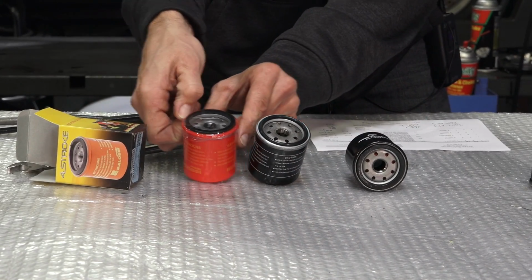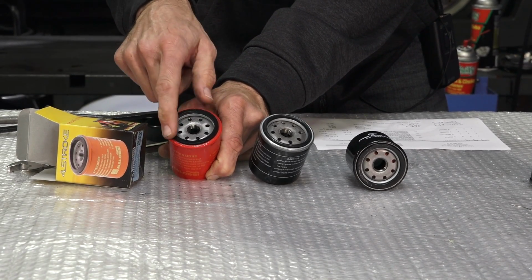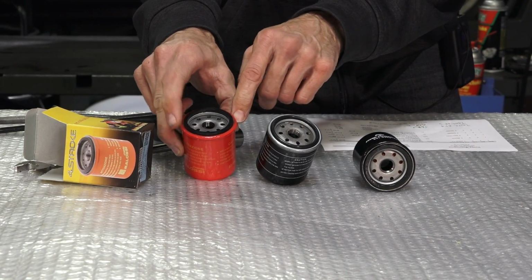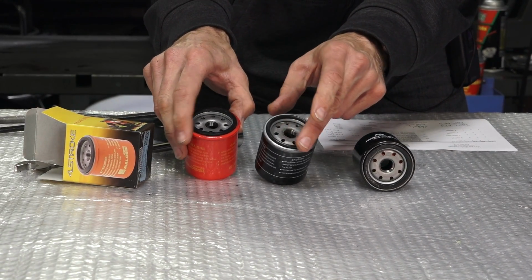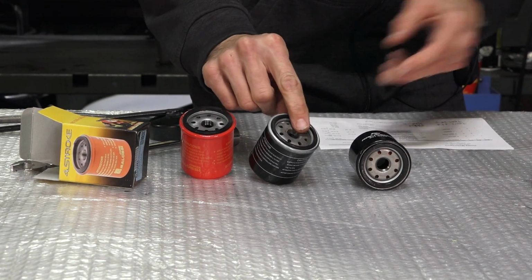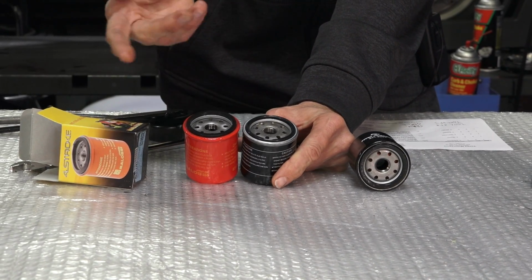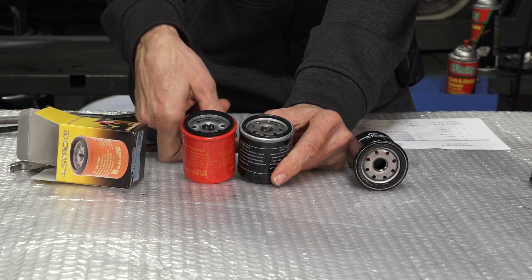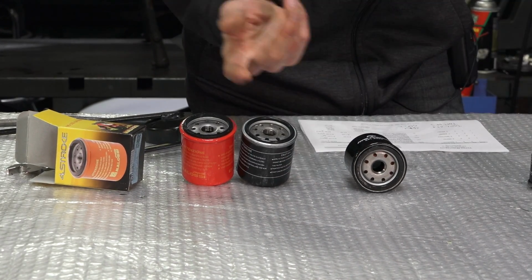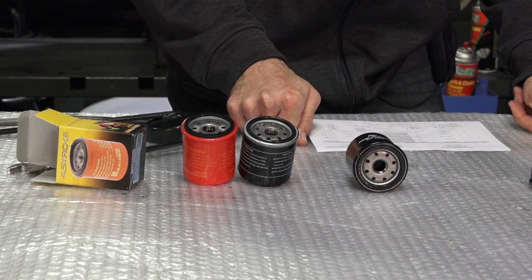And just like the premium aftermarket filter, it also has a lubricated square O-ring. So the nice thing is most of these filters have a pre-lubricated O-ring. If it has a dry O-ring or seal, I would recommend taking fresh oil and lubricating the ring before you install it. There's a lot of debate on whether you should fill up an oil filter with oil or not. It's such a short amount of time with the high volume oil pumps on the Vespas. I've done it both ways, but it really doesn't matter.